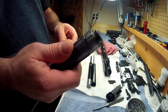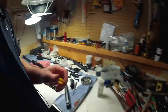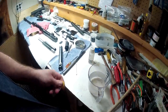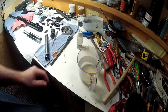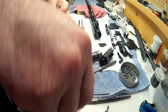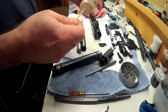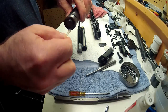When you want to put a new seal on, grab yourself some hot water in a container. Let your tap run hot, then stick the container in your microwave for about two minutes. Take it out and drop your seal in there and let it sit. While that's doing that, prep your piston — get a Q-tip and some oil or lubricant, here it's some shock oil, and run a little swipe around the piston button like that.